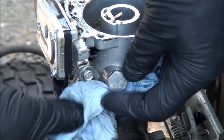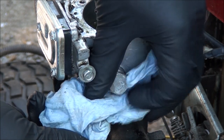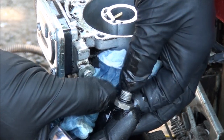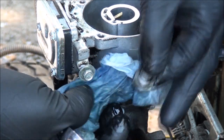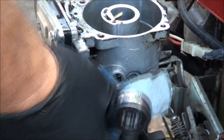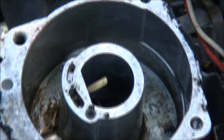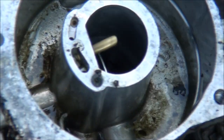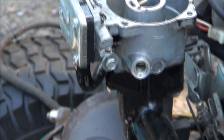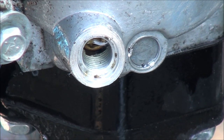There's also a little o-ring on this plug — you want to make sure it's in good shape. You can see the sediment a little bit better now. There's chunks of stuff in there, so we'll clean all that out. But what we also need to take out right now is the main jet assembly, which is located back in here — that's that brass plug.